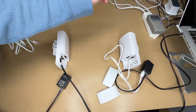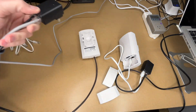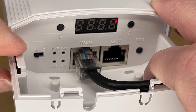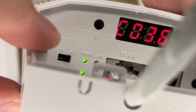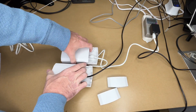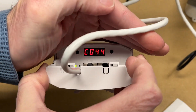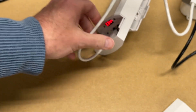I have internet right here so I'll plug this in, then plug both units into an outlet. There is a switch on each unit labeled H and C — make sure your master is set to H and your slave is set to C. Then press the reset button on both of them. This one says H044 and the other says C044, so now this is set up in a master-slave configuration.